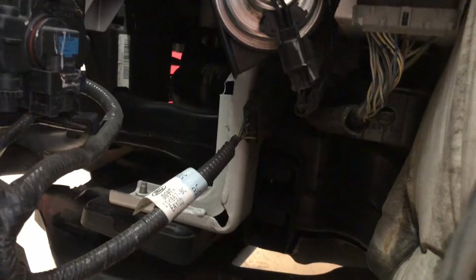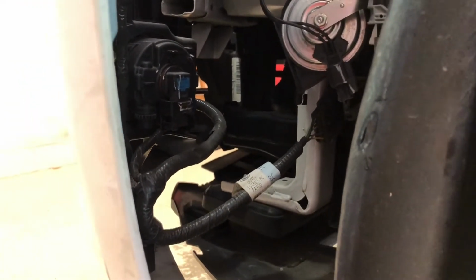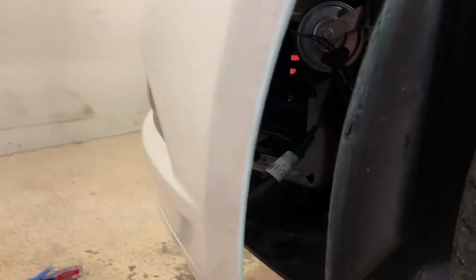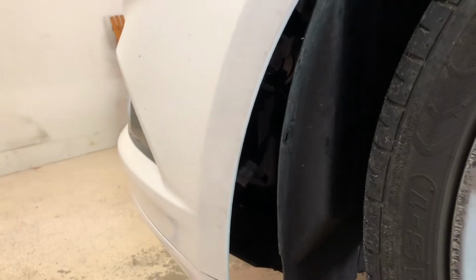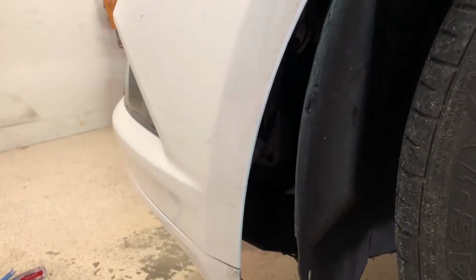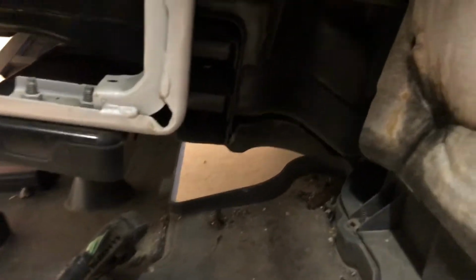So there's a plug that goes back in here. Because when we take this off, that fog lamp bracket, some of this wiring harness is going to go with this front bumper cover. So I'm going to disconnect those and get the other side undone, and then we'll slip this cover off. So I've jumped in here. You have a plug there that I unplugged. I was plugged into that. This plug down here, this harness, plugs into that harness.